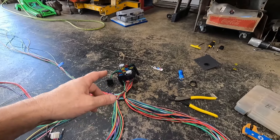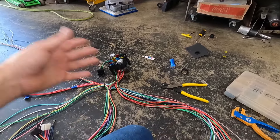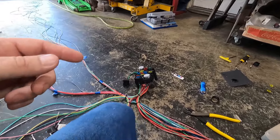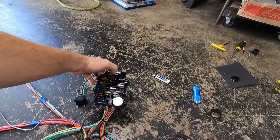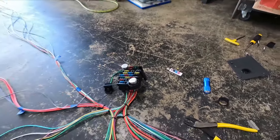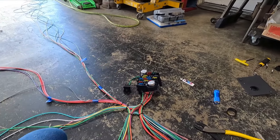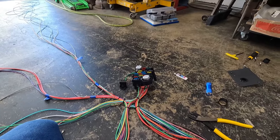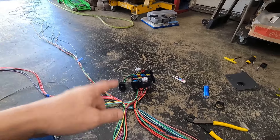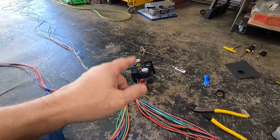This one in particular, Easy Wiring 21-circuit, it comes with power door locks, power windows, and cruise control — none of those three items are going on this car. So I actually unpinned the pins on the power door lock and the power window, took the pin out of the box. There's no fuse in there for confusion, and there's no pin at all for the power window and power locks. Those are separate fuses for that. The cruise control was actually piggybacked on one, so I clipped it off right at the pin.